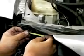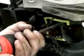Behind the projector headlights, we will see 2 holes. We will make a larger cut in these 2 holes by following the dotted line shown here, which will allow the projector to fit more perfectly. You can choose any method you like to make these 2 cuts. In this shot, we will use the drills, the pliers, and the sander to make these holes.